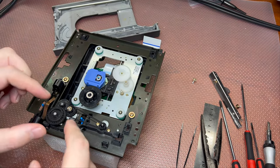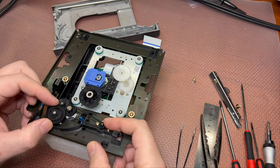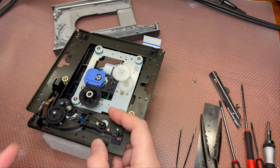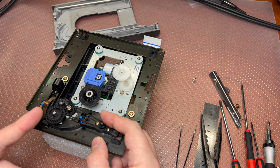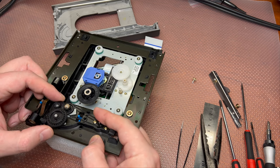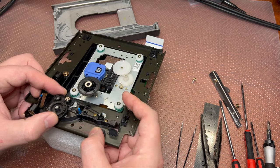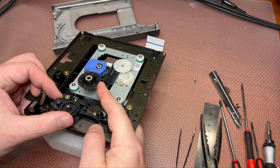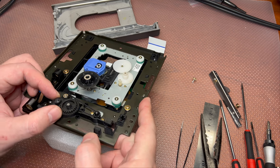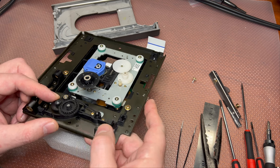And here I'm back. I lubricated and assembled these gears, so they work together like that. When they're in this position, they pull the carriage with the disc out and in. When the disc is fully inserted, they get into this position with the same motor. You see, the mechanism gets up to the disc and closes it here. And here is the blue switch, which senses the end of the operation and tells the motor to stop rolling.